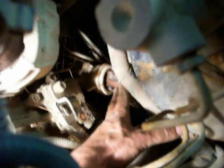Now we can go ahead and come in here. Right here is the steering. I'm going to have to pull this boot up, just like that. And there's a little bolt right here — I think it's 10 or 12mm or something like that. We're going to pull this little bolt out, and then we'll pull the steering off of the rack here. All this is, is the bolt sits right in here, and there's a shaft that goes in there, and that bolt holds the shaft from pulling out. So once we pull that bolt out, we'll be able to get the shaft out, and that part will be done. I don't even have to take the wheel off. I got that bolt out and it looks like they put something on it — everyone I've ever pulled out has had something on it, I think it's some sort of thread locker, because you don't want that bolt falling out. This is where the bolt was. I've got it pried off — I just took a pry bar and pulled up on it after I got the bolt out. So now that's disconnected.